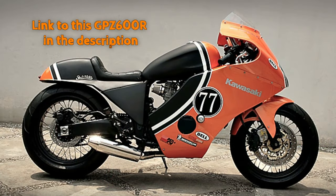So why do people want to put pod filters on in the first place? Well, there are a number of reasons. Maybe aesthetics — if you're doing some sort of a bike rebuild, custom job, bobber, cafe racer or something, then the airbox has to come off. But in the case of the GPZ 600, I can pretty much place a bet that most people are having problems getting their bike to run because the boot rubbers between the airbox and the carbs have probably gone hard and shrunk, and there's no real seal, and they cost about a hundred bucks a set to replace.